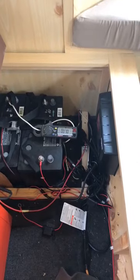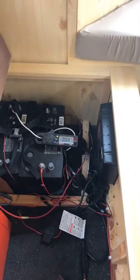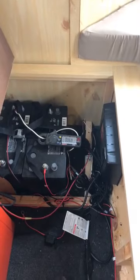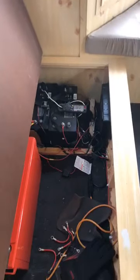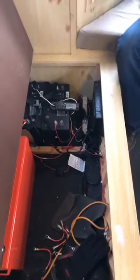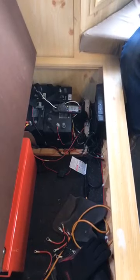If you take a look at the meter there, she all of a sudden jumped up to 7 amps just on the fire up, and now it's going to start working its way back down a little bit. The fire up on most pieces of electronics is always going to be bigger. If you look at the gauge right now, with just the lights we're talking about on the ceiling, the six there, and that furnace running, we're up to 7.2 on the house.